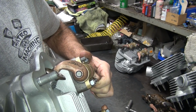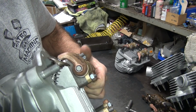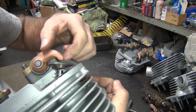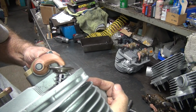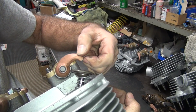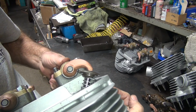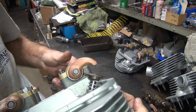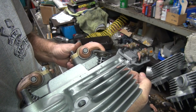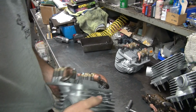So you can see how that works. So you see how it's sliding. It's rubbing really bad across the top of the valve, but at least it's on the valve. This one over here, it's off the edge of the valve. See, it's over here on the outside edge of it. So it's not even where it belongs. So all you can do is cut that edge of that valve off. That's why Harley blows the ends of them off, the tips. So each one of these has to be sharpened a little bit differently, or reground, I mean, to get what we need. So we have to do each one of these separately, back and forth, lots of times, which takes a while. But that's how you gotta do it to make them work.